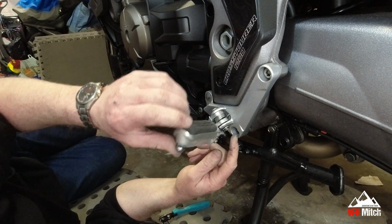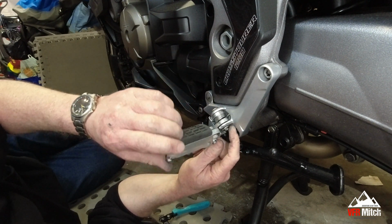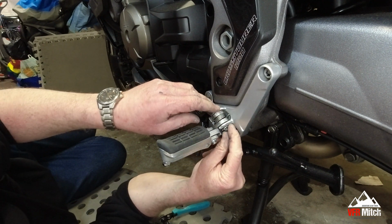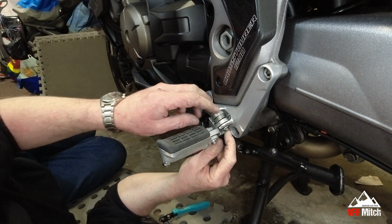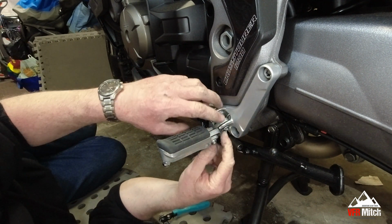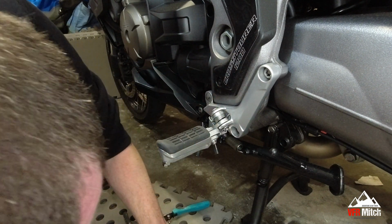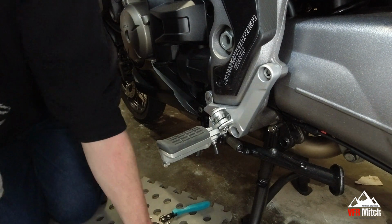What I might do is put a bit more tension back in that. I think that's recovered a bit since I've been faffing with that. So what I'm going to do is take that pin out again. I'm going to unwind the spring a bit, put it back in. I won't record this bit, so I'll be back with you in a minute when I've done it.